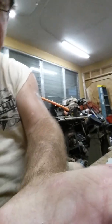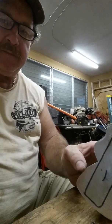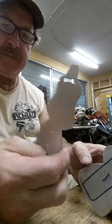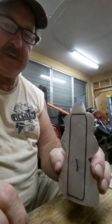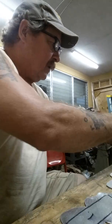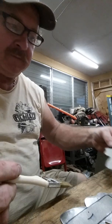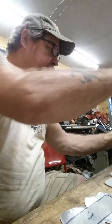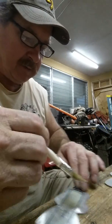So pretty much, from what I understand, that's the way you'd make a mega truck seat. I've already cut some out. I've got a template from all my other ones when I just used aluminum, and I just bend it up. Now we're going to add foam to it. I've already got some sets of foam cut out for the padding, and then take some contact cement, and we're going to do both sides of this.